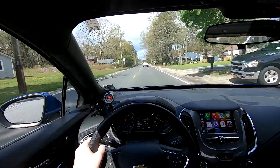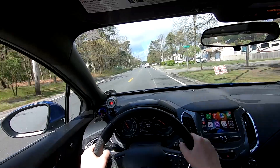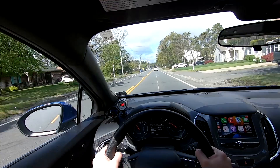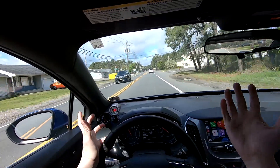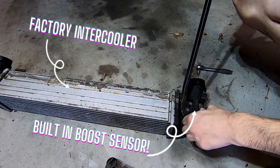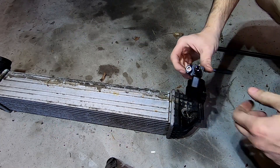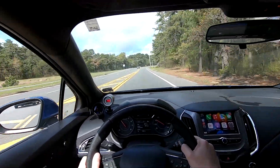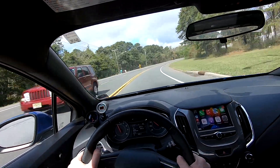That's the thing nobody realizes — intercoolers are always going to have temperature, but it's how fast that temperature drops. I'm definitely happy to put out products that I know are going to work on these cars. People are always trying to get the Mishimoto intercoolers because they're cheap — like 150 bucks — but they don't come with provisions to put a boost sensor in, they don't come with any piping or brackets. So by the time you're done making a Mishimoto intercooler fit, it's going to cost you about what it costs to put one of my intercoolers in, and mine is designed for the Chevy Cruze.